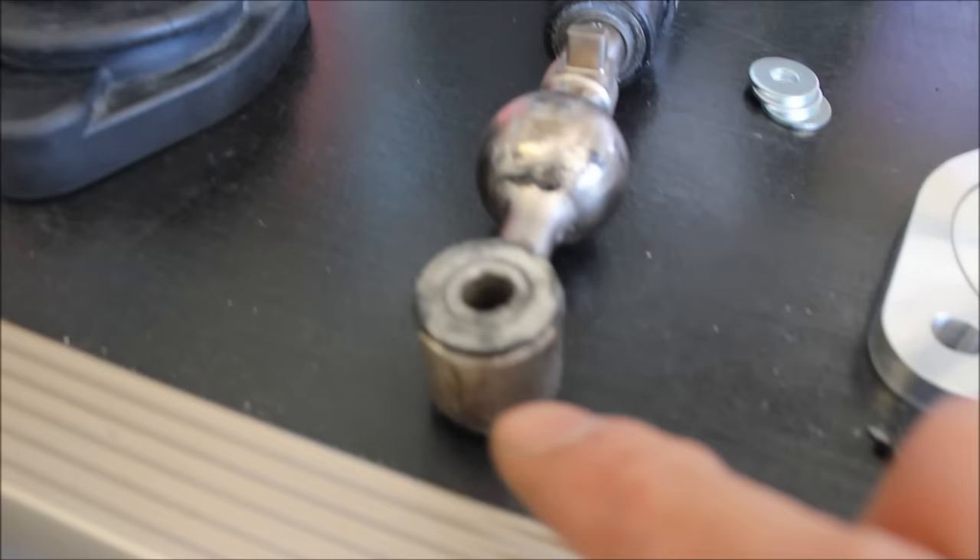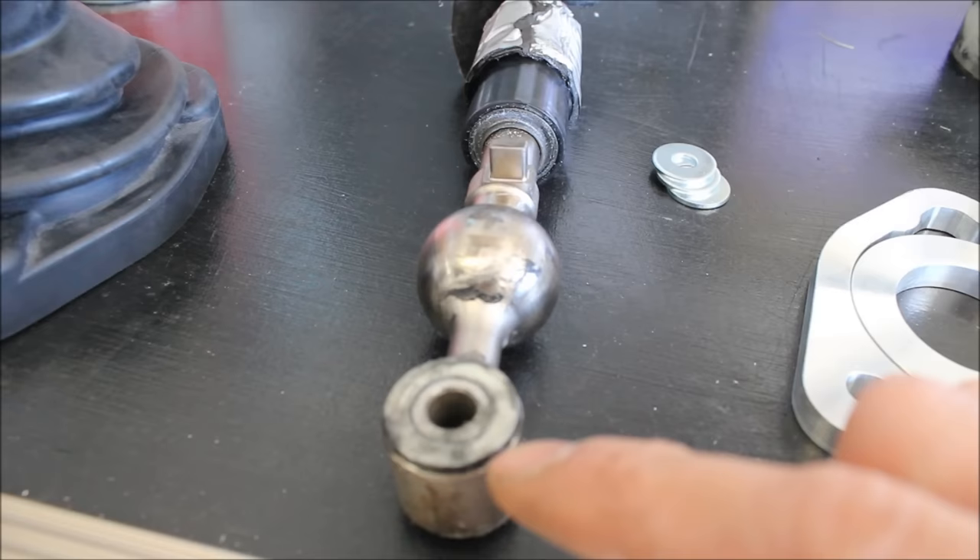The other main thing is this comes supplied with ball bearings in the linkage, and I think this is going to really tighten it up compared to just going with a nylon piece. Even if you went with a new nylon piece, I would recommend if you don't want to change out the shifter, at least change the bushing out to brass — that will give you a much firmer feel because it will have no give.